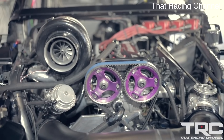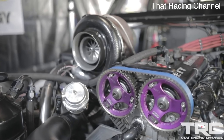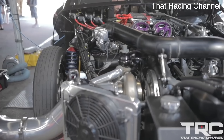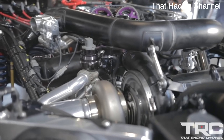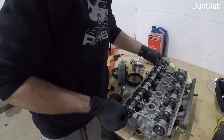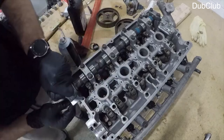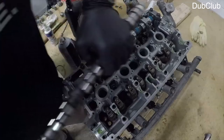The design, shape, and flow of the cylinder head is one of the keys to making power, and with the 4G63T, Mitsubishi did a pretty decent job on all versions. The earlier 1G intake ports are huge, and it's often argued that the 1G head is better than the 2G head because of port size — but looks can be deceiving because port size isn't everything. The 2G head has smaller ports but a straighter design that provides better air velocity, and in pretty much all applications other than massive turbo race cars, the 2G head is actually better across the entire rev range. The last version of this cylinder head on the Evo 9 used a design similar to the 2G head and also featured MIVEC, Mitsubishi's variable valve timing system.